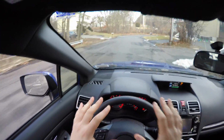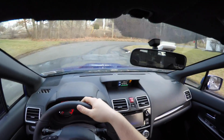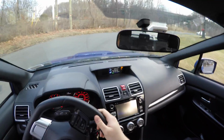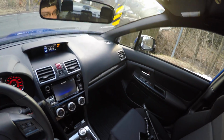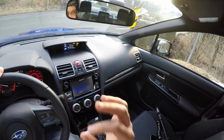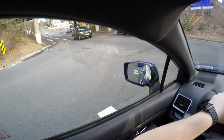You want to go a little bit slower off the clutch when you're in second. Going into higher gears, a little bit different. Also, creeping, kind of like moving or inching, it's very hard to do and it's not good to do in a manual transmission because that really wears out the clutch.